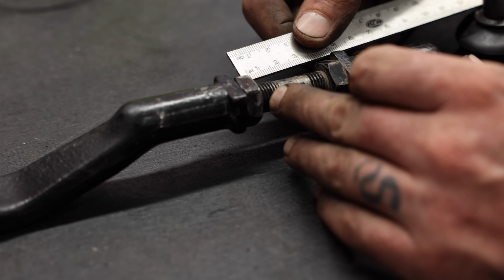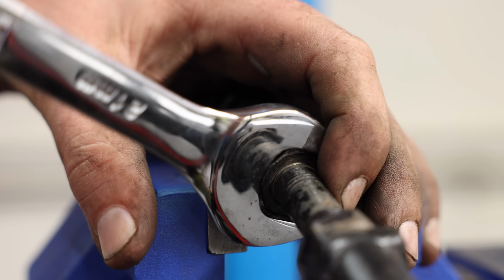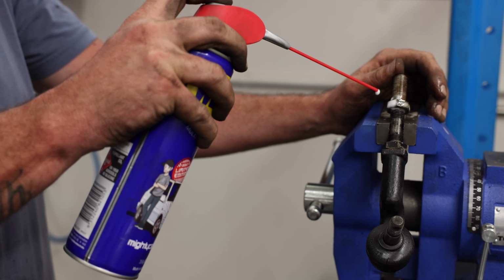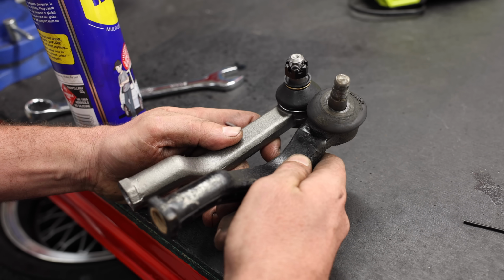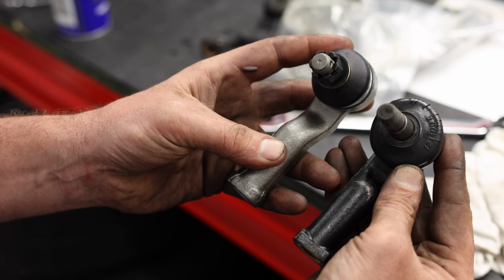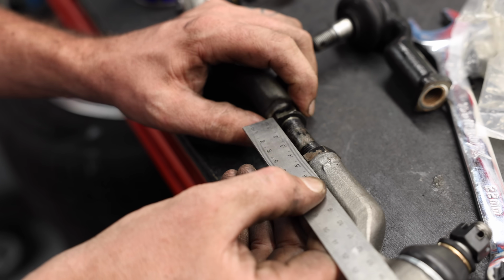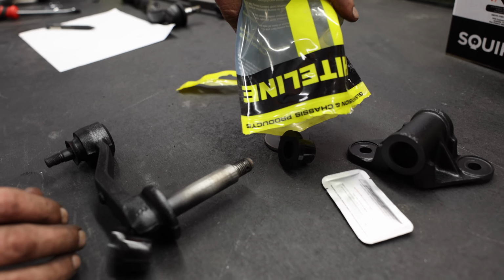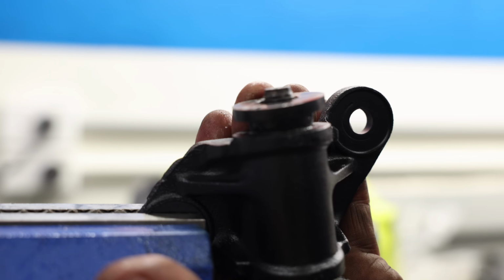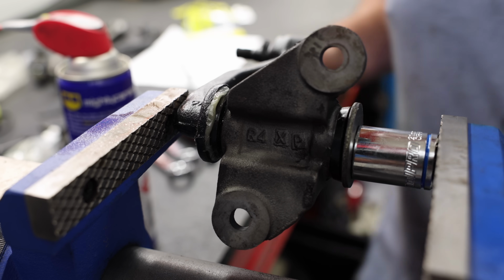While we're finishing off the rear end, Paulie's going to reconnect all the front steering gear. It's more often found in trucks these days, but Mazda used them back in the day. It has a collection of linkages and tie rods that you adjust in an alignment to get the car handling the way you need it. They're often a little bit vague around the centre and often feel sloppy. We've replaced every possible part of the system to make it as good as it can get, which is arguably still not as good as a rack.